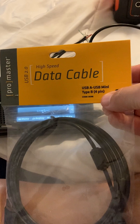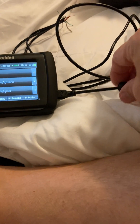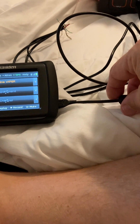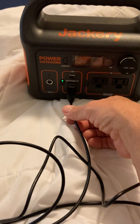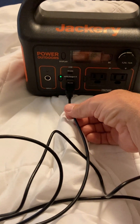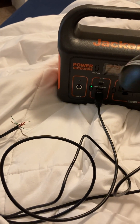What I've done is I took a cable — the Uniden has a type B four-pin connector, which is kind of rare. I cut it in half: half of it uses that little rare connector, and the other half you plug into your USB outlet in your car to get five volts of power to power the GPS.